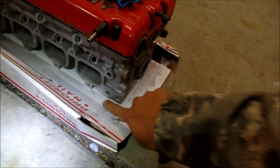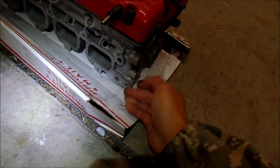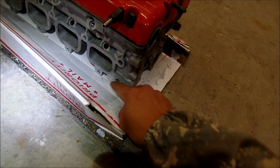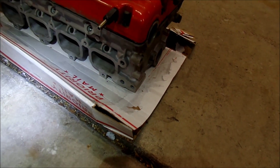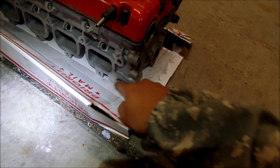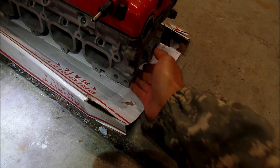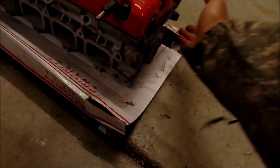I think this is a good design, but look — there's just a channel where the exhaust comes out here in the head. I kind of like the idea of just having a pipe coming from the front going to the intake manifold, because you can replace the pipe, you can clean the pipe out. This one the inside is not accessible, so all the carbon stuff will get stuck in here — that makes it hard to clean. But this one actually wasn't too hard to clean, and it wasn't very plugged at all. It's clean now.